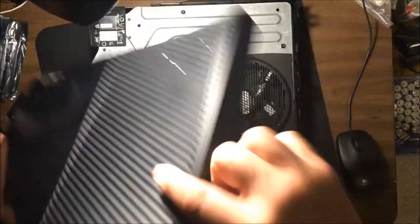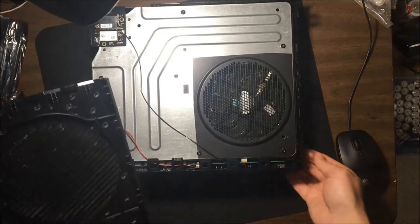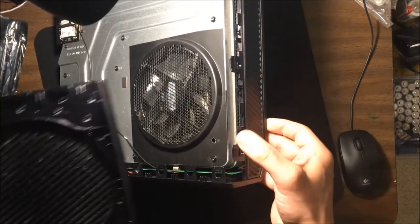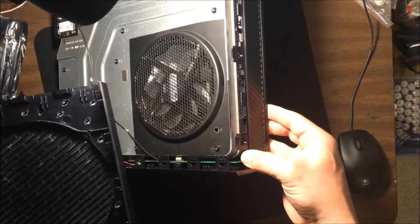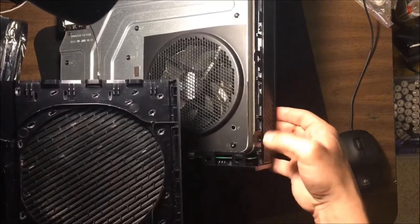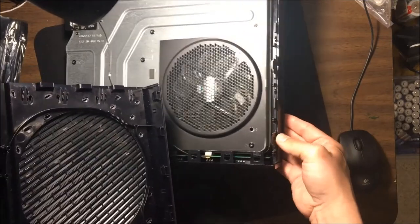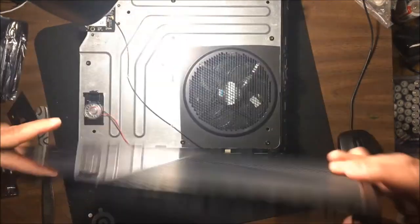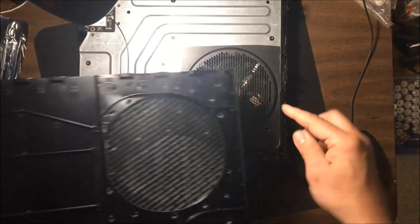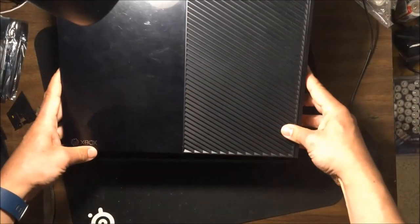Oh, yeah. So my point was there is a clip on this side. So this is the only one you have to be kind of aware of. On this edge right here, if you can see that, this first clip goes in here, and this and this go here and here, and then there's a little clippy thing, a holder, that goes in there. So just be aware of that. When you're putting this top case down, you want to make sure that this clip isn't hitting this or this. It's going right in the middle. And if you line that up, it'll fit together really nice.